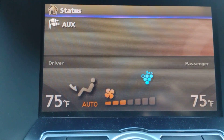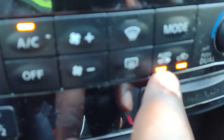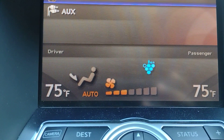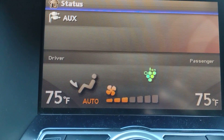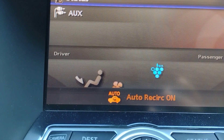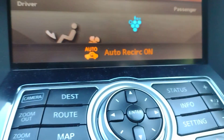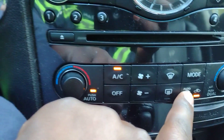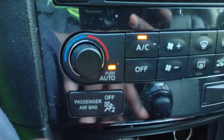It will keep swapping between clean and ion control — I don't think you can stop that from switching. However, if you prefer to change your settings and force it to either recirculate or get outside air, let's say you force it to get fresh outside air — you'll notice it goes immediately to ion control mode, green. If you force it to recirculate, it's still green. But if you set it to automatic recirculation, it goes blue. That's why I've always said it just makes sense to leave these systems in auto.